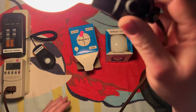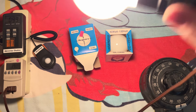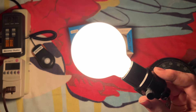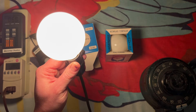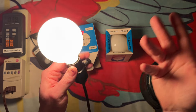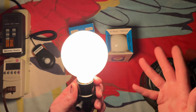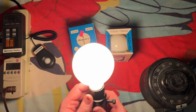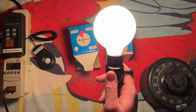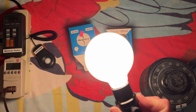If I hold it up here about two feet away from the lux meter, we're getting about 42 lux right now. It's a very pleasant color of light, very warm. I could see this being in just an open lamp, like your vanity. But it's just so dim I don't really see it being used in a vanity in the bathroom, because it doesn't emit that much light unless of course you have a bunch of them together. We're currently at 38.2 watts, so I guess 40 watt or close to it naturally.